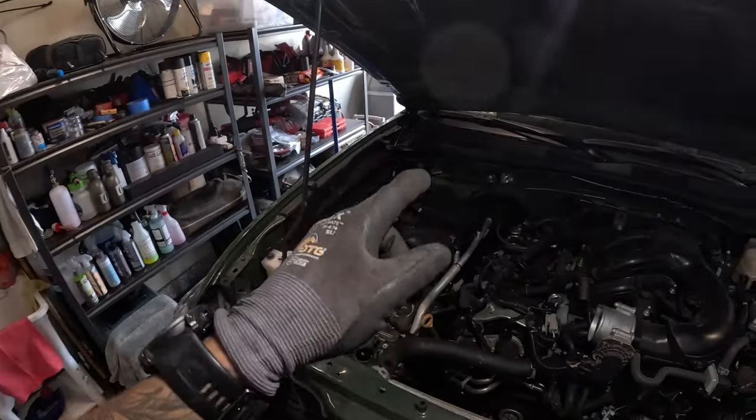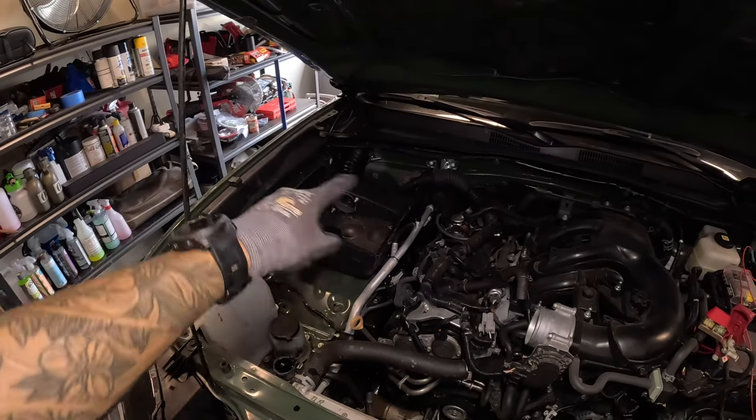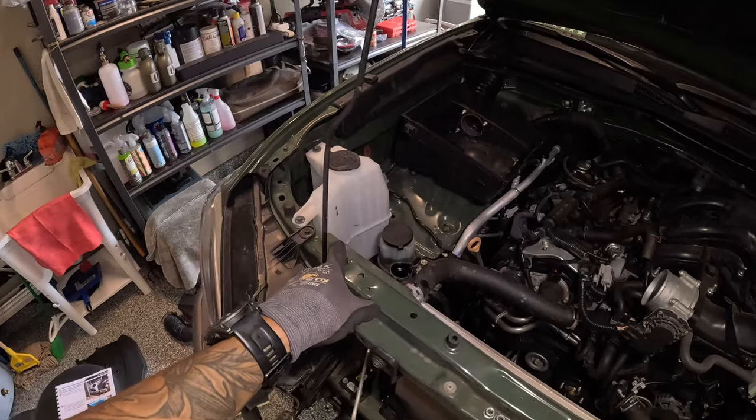Just keep in mind when buying these kits — they have different options. If you have like a passenger side or driver side ABS, off-road models typically have ABS on the driver side. You can also choose an open filter or keep the factory air box. Because I have the cowl intake mod in the back where the ABS would normally go — which is typically where you'd relocate the battery — I chose the kit that has ABS on the passenger side and relocates the battery to where the washer reservoir is.